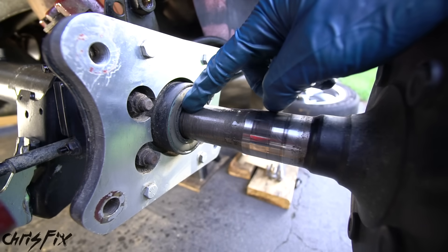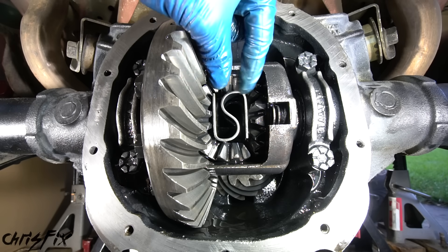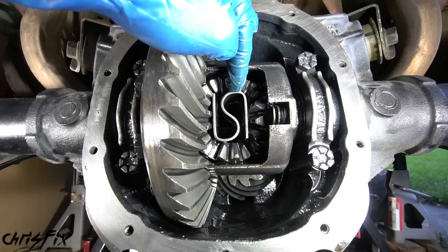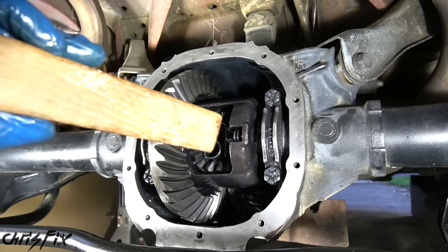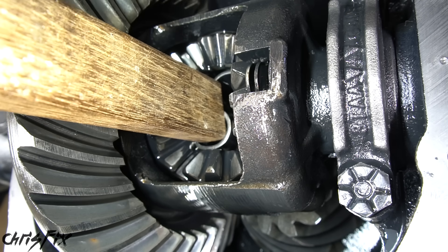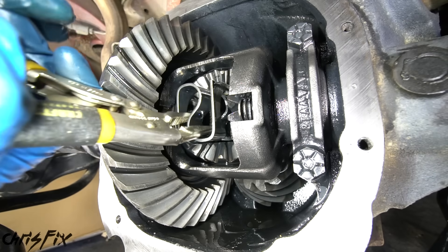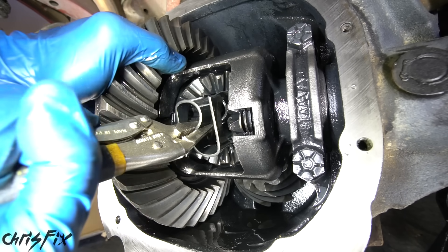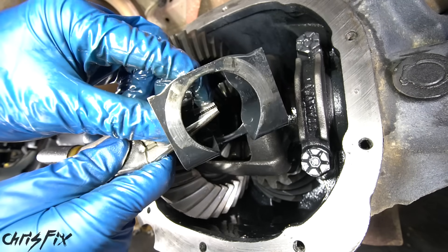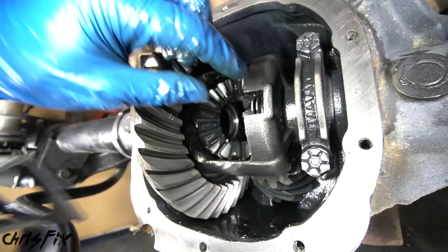Since I already did it, let's go back under the car and remove our S-spring. Now this spring is compressed and under tremendous pressure, so you have to be really careful and make sure you have your eye protection on. To remove it, use a hammer — I like to use a piece of wood that fits right over the spring and carefully tap it until it can't move any further. Then spin the carrier to get to the spring on the other side. Clamp onto the spring with locking pliers, give it a wiggle and pull it out — you might need a screwdriver to help pry it. The clamping pliers will keep the spring secure as you remove it.